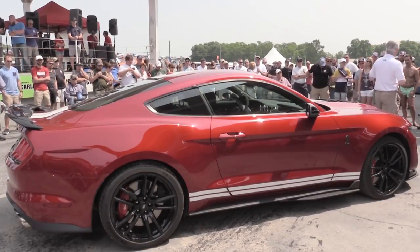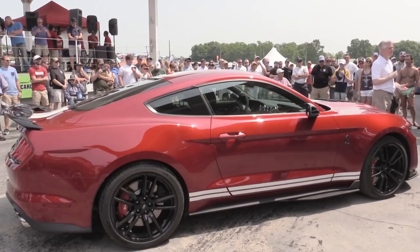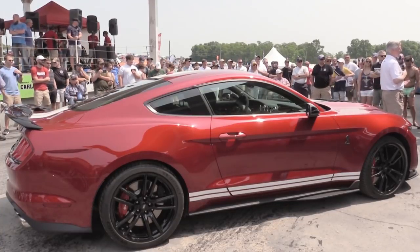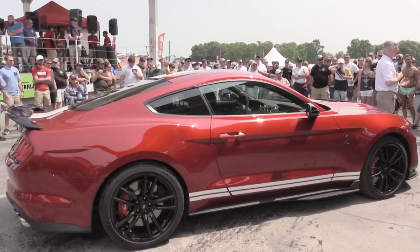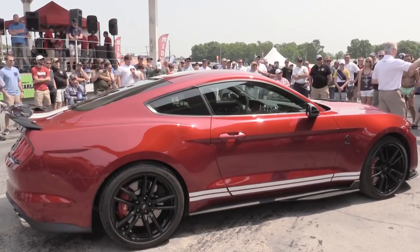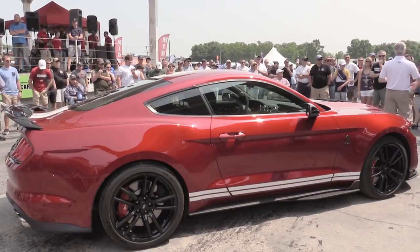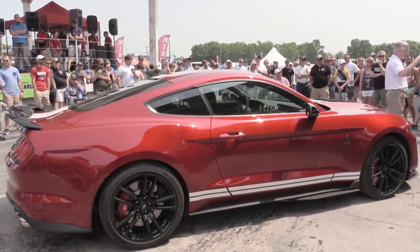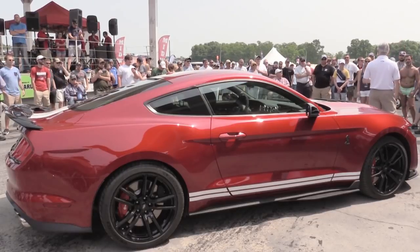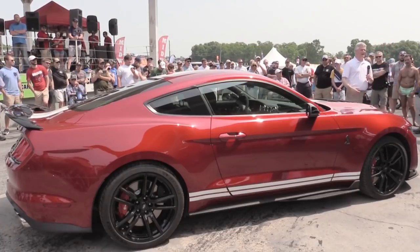And then from the MagnaRide system that we've been using both on the base Mustangs and on the 350s, we got a big partnership with that supplier called BWI, that we actually got new algorithms with, and then we can change the setup of that car 1,000 times per second, right? So as you go through the different modes of normal, sport, track, they all give you that different capability of, hey, I'm going to choose this selection to be this stiff as you go into a turn. We're measuring ride height sensors in each corner. We're measuring your G's, right? We're measuring your pedal position. And we'll decide how to set up that shock electronically to really give you a flat, planted feel.